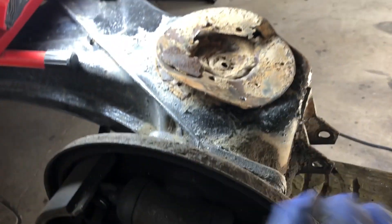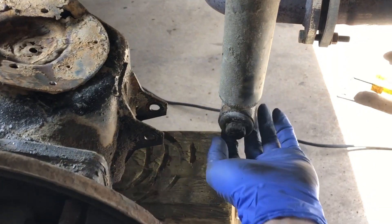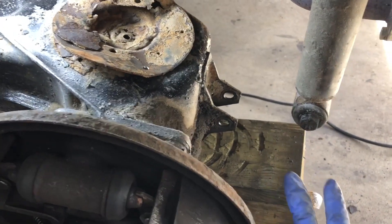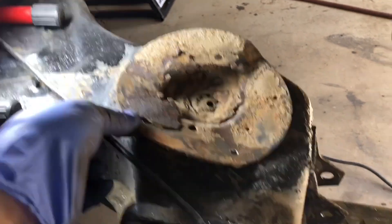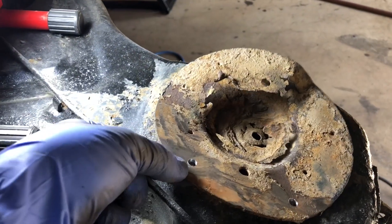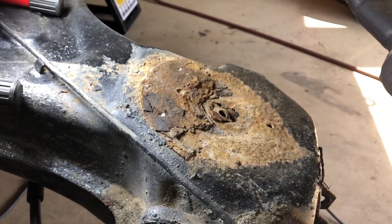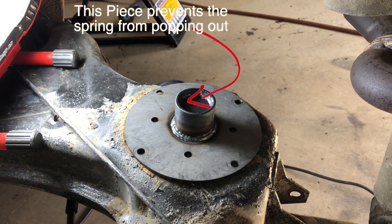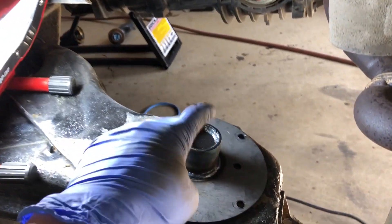What I've done is put a block of wood here just to lower the control arm - the lower control arm. I took the spring out; not actually a big deal - one bolt, 19 millimeter on both sides, this comes out and you just lower it down with the jack. I drilled out this plate - there's only two holes that were actually holding it - so the plate comes off just like that. You can get a new plate and it'll go right on, then put a rubber bumper there and put the spring back on, and that'll fix our problem.